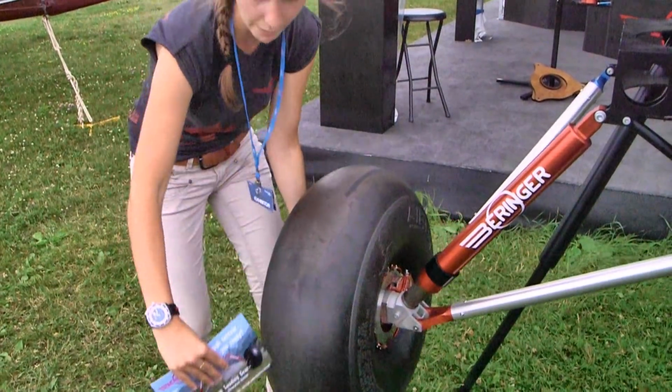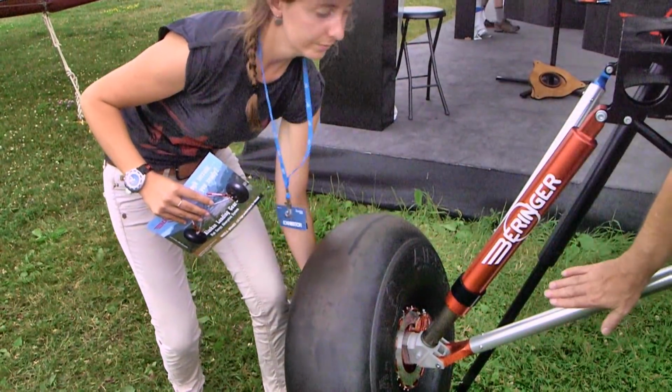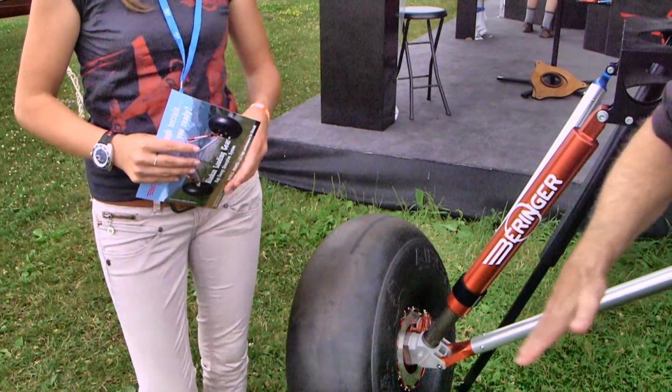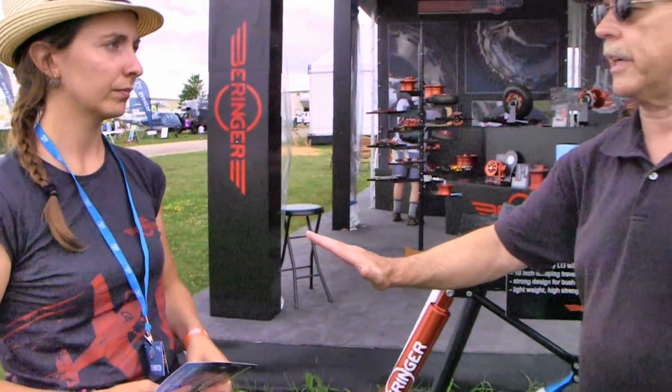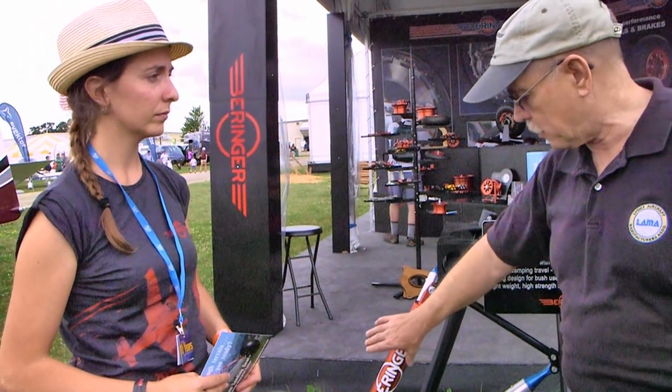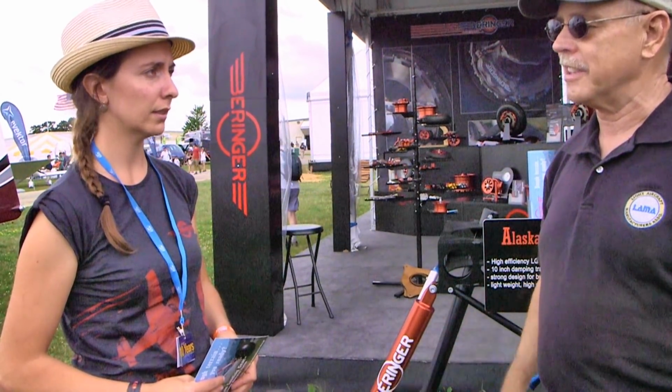You see the line of the tires? It's not deviating as much as it would when the strut is down here, where that tire will just slide out to the side. True. Which means more wear on the tire, but also less total absorption. So you're making this work harder even with that long travel that it has in there.